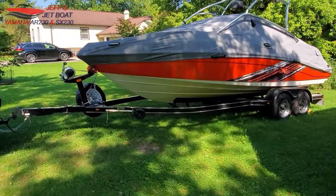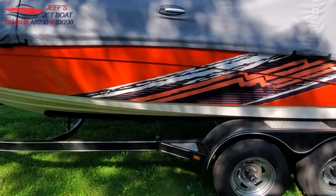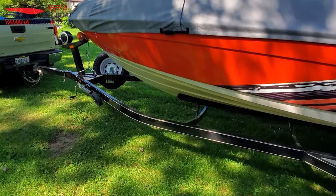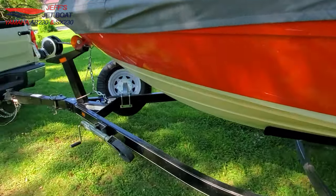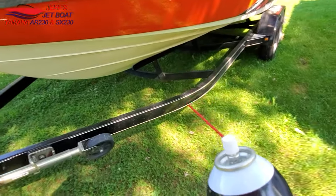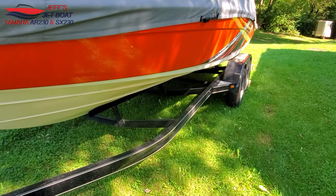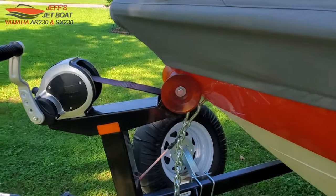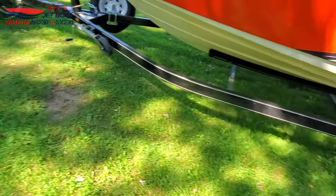We use our boat constantly — two nights during the week to wakeboard and usually one day on the weekend, so three days a week. The reason I don't say to spray both bunks is you can make them super slick, but once it's latched up front and secured in the back with the safety chain, it's not going anywhere. You may notice that if you pull the boat all the way up and there's slack, the boat might slide forward slightly on a hard stop. If that happens, just take the slack out of your winch and give a couple adjustments in the back.